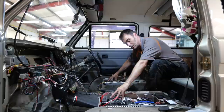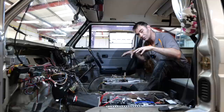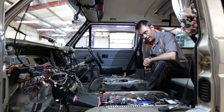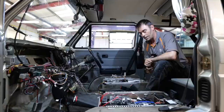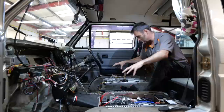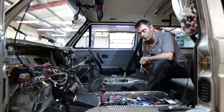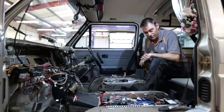The reason why we've got two DC-to-DC converters is because of the induction hob — it's a 2.4 kilowatt induction hob, so we need to get power to that. We've got to take the 400 volt DC down to 12 volt DC, and then 12 volt DC back up to 240 volt AC. There is a system we're testing — a 400 volt to 240 volt AC converter — but it's a little too early to put in this vehicle. On future builds we'll probably do it that way, but on this one we've had to go with two DC-to-DC converters to support the 240 volt AC 2.4 kilowatt induction hob, the fridge, and other electrics.